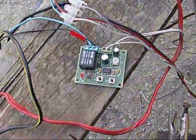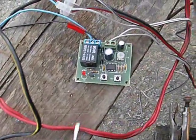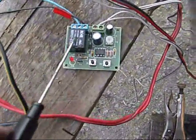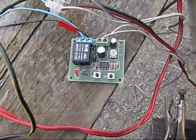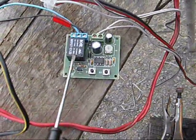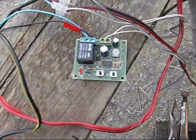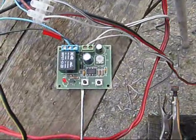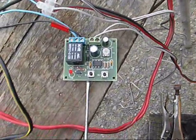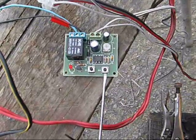This is the timer that I bought off eBay — it was a few dollars, not enough to be worth worrying about. The idea is that it has a relay here that will be used to drive a big relay to make the thermostart go. That relay itself is not big enough to handle the current of the thermostart, so you need something like a headlight relay in between. It's got two buttons: the first button is to start the timer, and the other button is to stop and reset the timer.